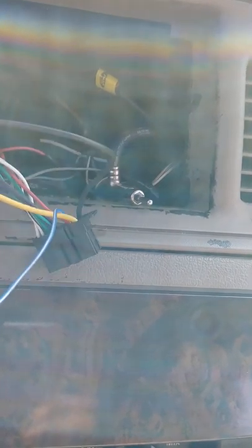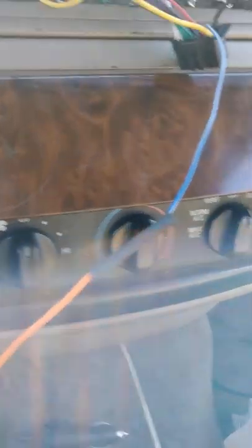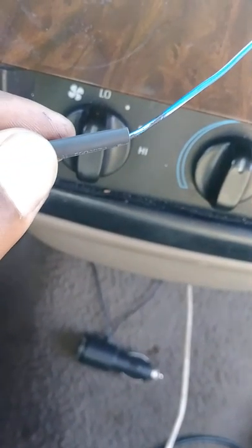This is my remote wire. Like I said, they're usually blue, but check with your user manual for whatever head unit you're using and make sure it meets compliance — whether it is blue or whatever wire it may be. So we'll go ahead and get that in, attach it, and I'll be right back. We're back, and I got my wires hooked up. I got my heat shrink which is going to go right over it.